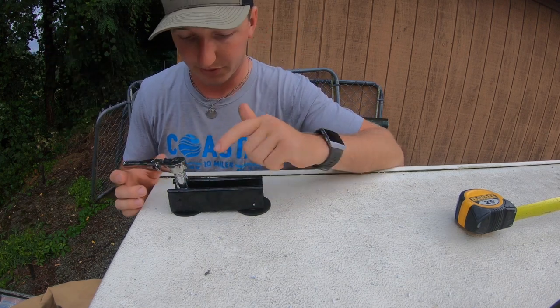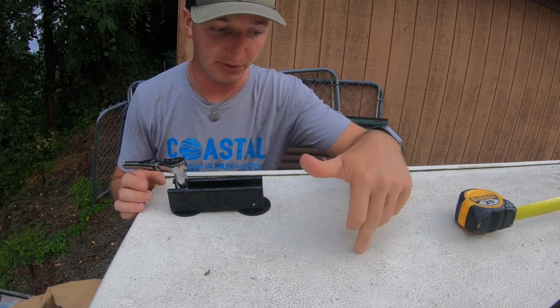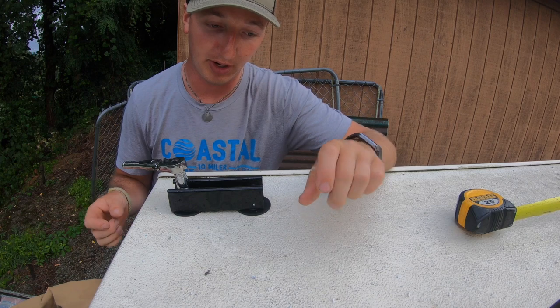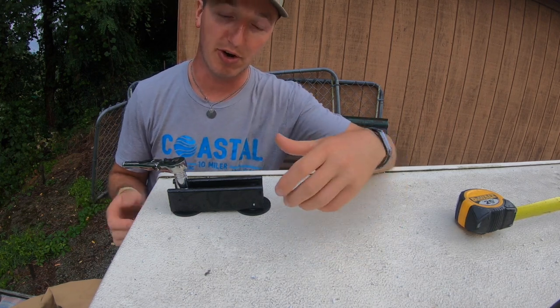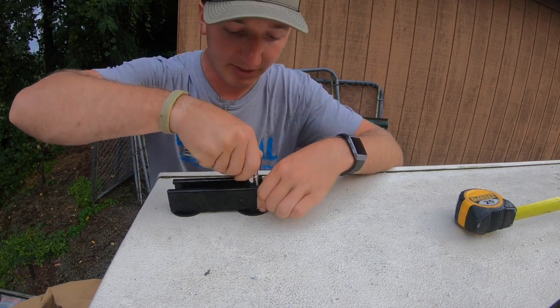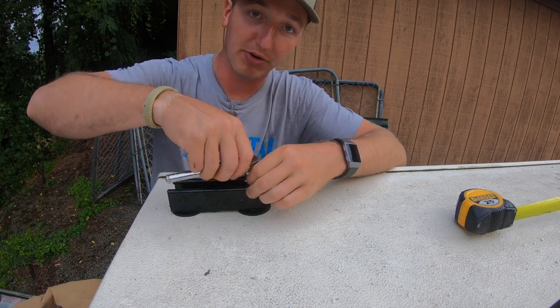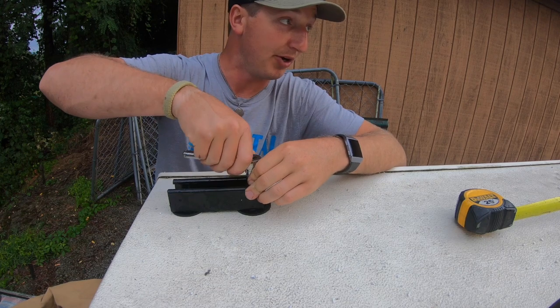It's important when you're tightening these, you don't need to crank them down super tight. It's a really thin roof. There's a layer of foam insulation, and then there's another thin layer just like this on the inside, and you don't need to go so tight that you're crushing that and pinching it. With the two bolts in each spot, it should be plenty tight to be able to hold it without damaging your pop-up or your roof on your regular camper, whatever you're mounting a rack to.